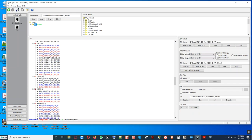All right, looking for address 37. It's not showing up here. Amplifier, DAC. Yeah, here it is right here. AMP, is this it? Yeah, that's it, 37. It showed that the coding file is in, right. Yeah, this is it. Address 37. We're gonna flash and code that one.